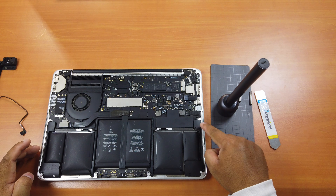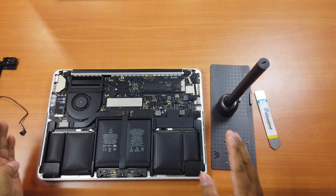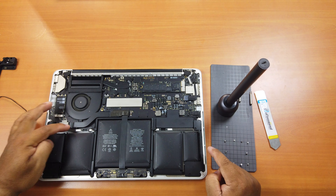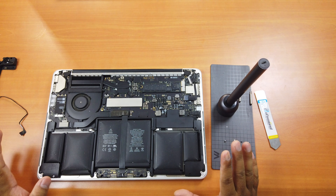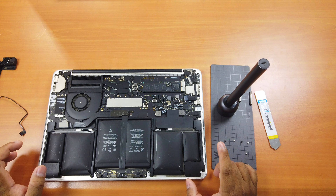So the speaker is here. This is the left speaker — it's on my right-hand side, but if you flip it over it's on the left. And this is the right speaker. Removing the left speaker is faster and easier. For the right speaker, you have to remove a part first. But before you start removing, it's very important that you detach the battery first, just to be safe.